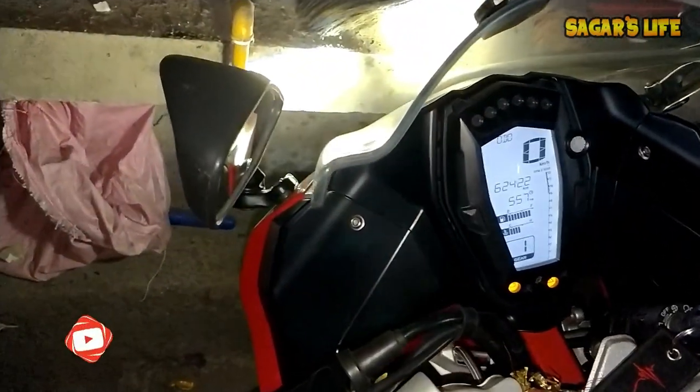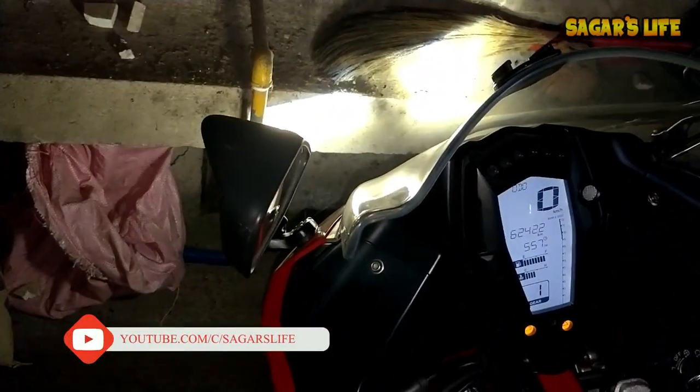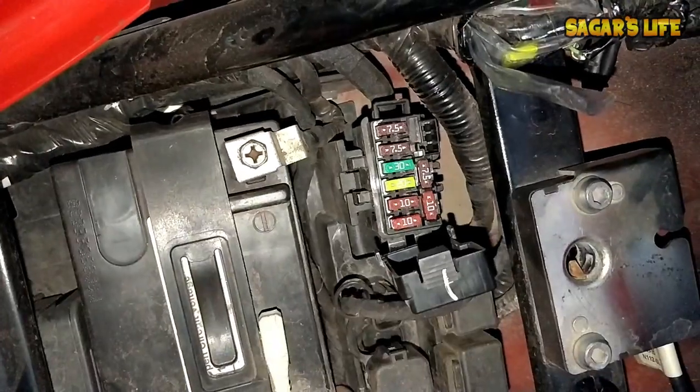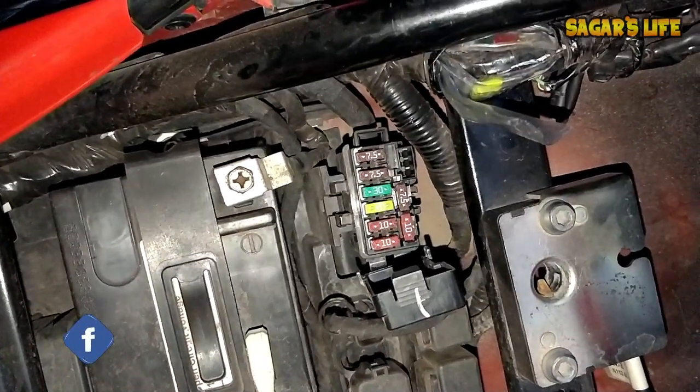It is not honking now. You can also see the headlight is fluctuating a little. That means there is still extra load coming from the battery. So now I directly need to change both horns back to stock here.